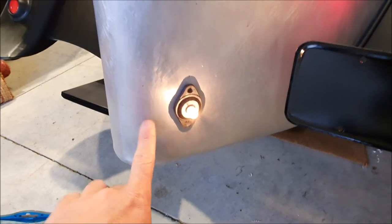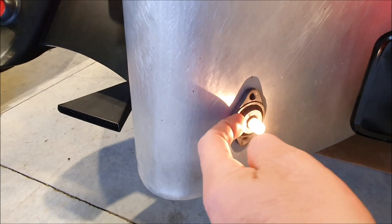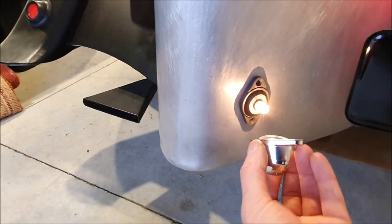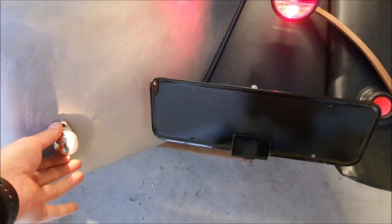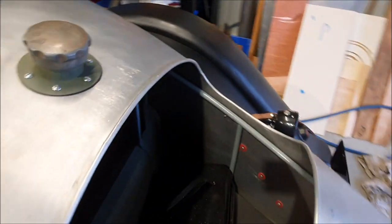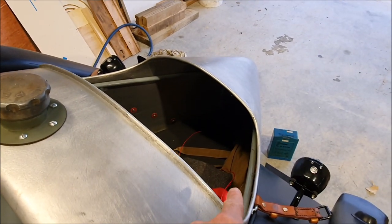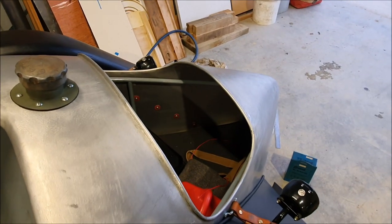This is how the lamp looks mounted on the body of the car. Around the outside of the bulb holder I fitted a piece of rubber tube, and it just happens that tube is the same diameter as the hole in the middle of the rubber gasket that came with the light, so that holds everything in there quite nicely. The cover will just bolt on like that and should provide enough light for the number plate without being too bright, with no white light shining directly backwards - which meets the requirement in New Zealand. Because it's earthing through the aluminium body it's just a single wire, tied up to the steel chassis rail to keep it out of the way behind the boot.